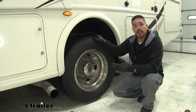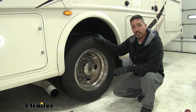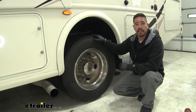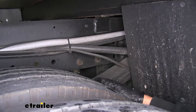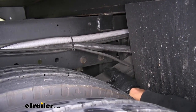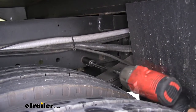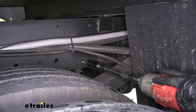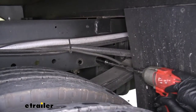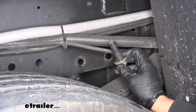To begin our installation — we can do the entire install with all four tires on the ground. You may want to lift the back end using the leveling jack so the suspension can hang down a little bit, but make sure you have jack stands in place to support everything. We're going to come to our rear axle in the wheel well area. If we look on the frame directly behind the tires, we're going to have two bolts at the bottom of the frame that we need to remove. We'll take a 21mm socket and an extension to reach in. There are little nuts on the back, but they have keepers on them, so we won't have to worry about holding them with a wrench. Now that we have both bolts removed on this side, we're going to take the other side out as well, but hold on to the hardware because we are going to be reusing it.